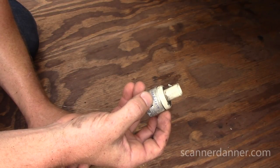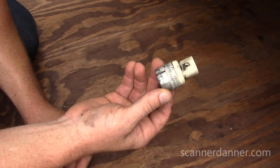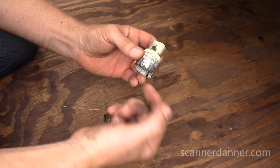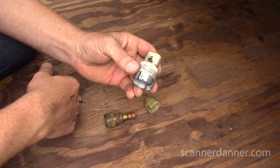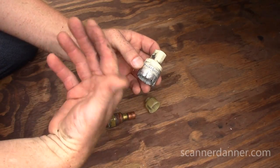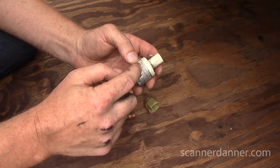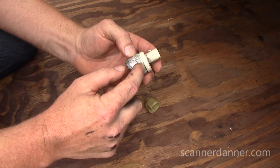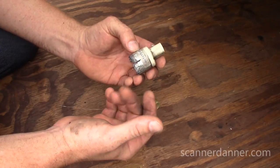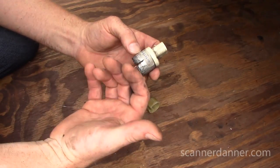The number on this switch was 1002-07988. I assumed it was a Cummins part, but it's not — it was installed by the manufacturer of the gauges. Trying to locate this part, I found some with the same part number anywhere from $150 to $250. With further research I found there are a bunch of different temperature ratings — two more digits after 07988 that don't exist on this one. These go anywhere from 185 degrees all the way up to 250 degrees depending on those last two numbers. So I didn't know what I was dealing with.